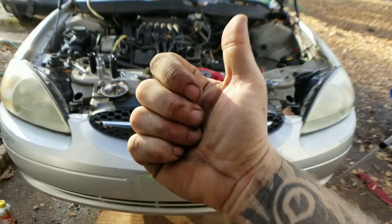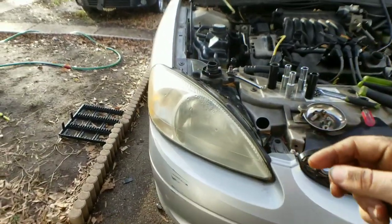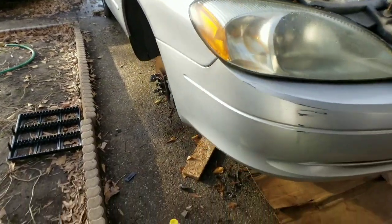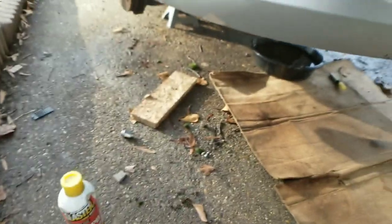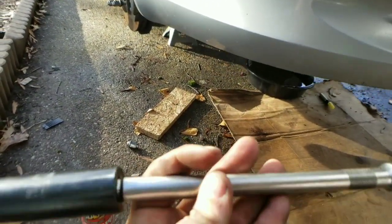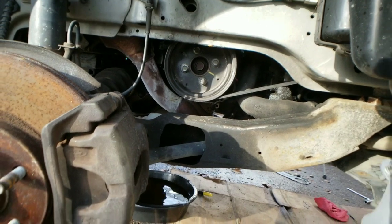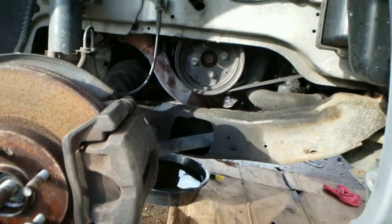All right, drain the oil pan, mark the torque converter bolt. Yes, the socket you need to spin the motor. One second, where did I put that thing? Ah, here it is. You will need a 13/16. You see that right there, guys? Hold on. Oh. There we go. All right, 13/16. I'm using a 12-inch extension. Went ahead, put it on the crank pulley, spun it until I saw that bolt. You're gonna keep spinning until all those bolts are out, and then the torque converter is done.